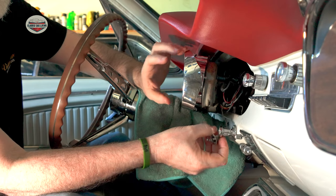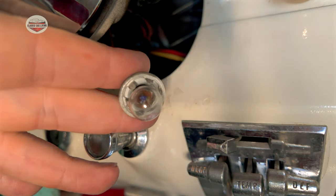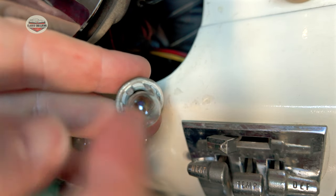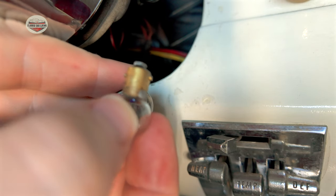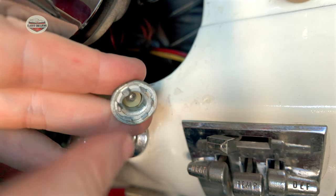I'm going to reach back — you don't spin them, you just pop them out. Here is what you have: your incandescent light bulb. What you're going to do is a little push in and then a quarter turn counterclockwise. Push in, quarter turn counterclockwise — and there it is. See the little notches?